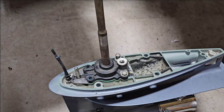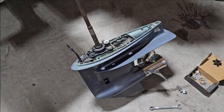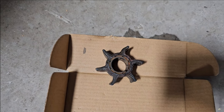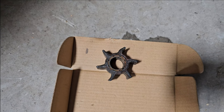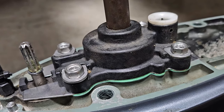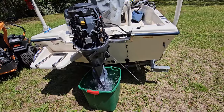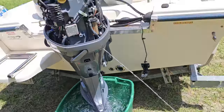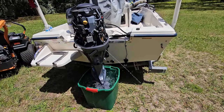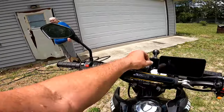I don't know why it wasn't pumping water. Put a new thermostat. Pumps water through under pressure with the earmuffs. So maybe that is worn enough. I don't know. I've seen worse. Even come with new stainless bolts. I would definitely keep those old ones too. Success. It's peeing. And that impeller didn't really look that bad. That's crazy. Alright. Stay out of trouble.